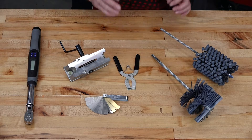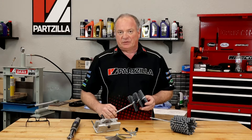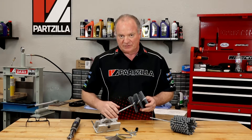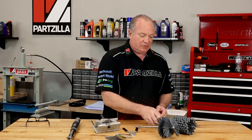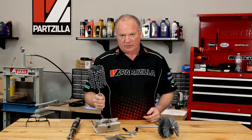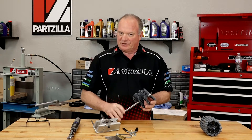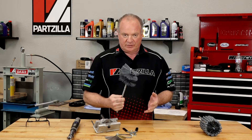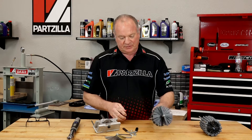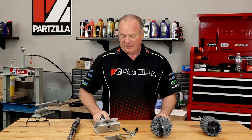Now I want to show you something really special. With the Raptor 700 engine, it is actually a Nicosil coated cylinder, so you don't treat it like a regular steel insert. If it were a steel insert, you'd be using a hone something like this — but this is the last thing you want to use for a Nicosil cylinder. For the Nicosil cylinder, we basically just want to clean it up and take off those rough edges, and to do that we're going to use a nylon hone. You definitely need to pick up one of these because the regular ball hone is going to destroy your cylinder.